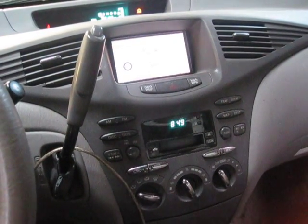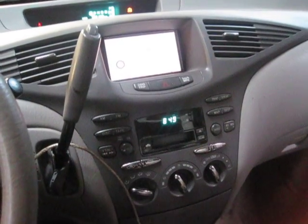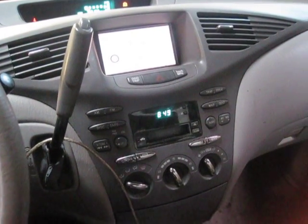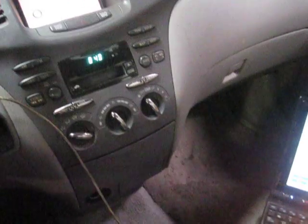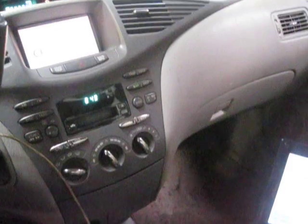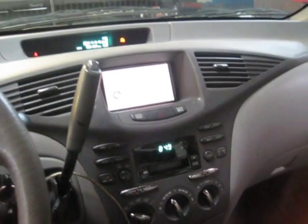This car — we actually put a high voltage battery in about three months ago, and it went to the dealership. It has this code P3009, so we're very interested to see where the leak is coming from. If it's inside the battery, then obviously it's a warranty issue, but if it's coming from somewhere else, it's not.